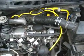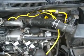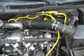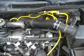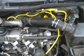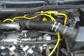The only problem I had was that the turbo wouldn't stay on consistently. If I was driving above around 1800 RPM, the turbo would kind of drop out and the computer was saying I had an overboost or underboost. It turned out that it was the hoses — you can see those, the new yellow silicone hoses.